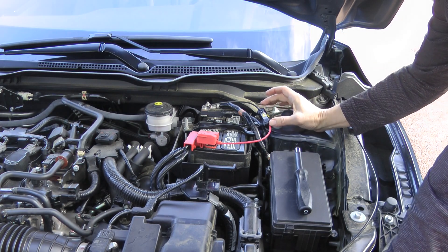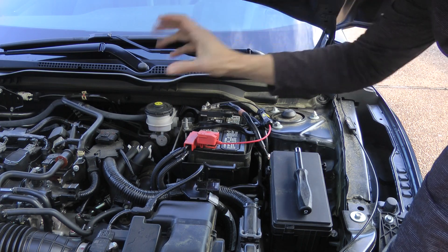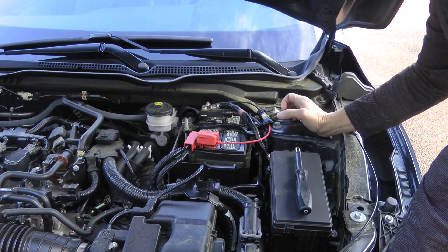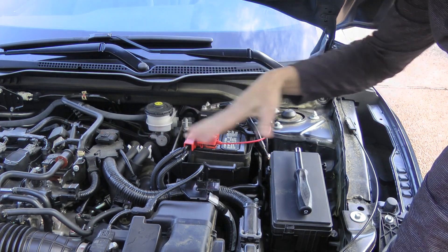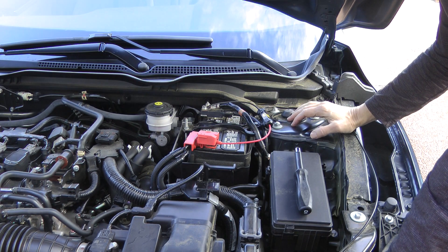What it's doing is acting as a transient suppressor. If the voltage gets too high across the battery — let's say from an EMP that generated high voltages in the vehicle cabling — the transient protection device will turn on and limit that voltage so it doesn't get so high that it causes damage to the systems connected to the battery in close proximity. So it's part of a multi-point protection system for protecting against an EMP.